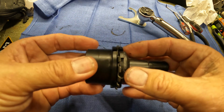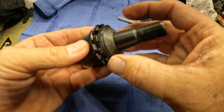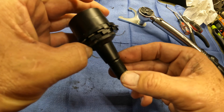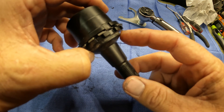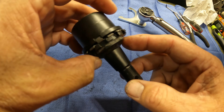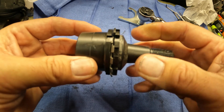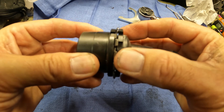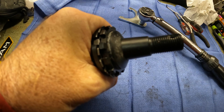Be sure to read the instructions — don't rely on this video for everything. When you do get this installed, you should check your ball joints for vertical play. Apparently there's a small tolerance for vertical play — I think it was five hundredths of an inch, 0.05 inch, that's allowable. Once you get these installed, if you do have more play than that, they're saying you may need to put a little bit more torque on this, more than the regular 10 foot pounds.